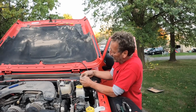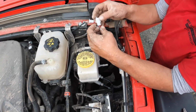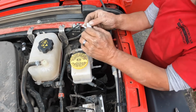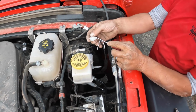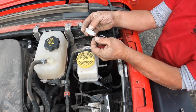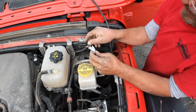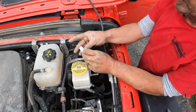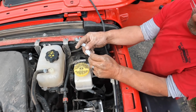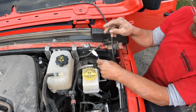Now we'll put the pins back in. We'll line up our connectors here. Red one goes in this cavity. There we go. Black one goes in this cavity, in this direction. We need to make sure that we push them in until they lock into place. There we go, heard the click. Now the white one goes in this cavity, this direction for the tab, locked into place. And the last one is our blue wire, which, if you remember, matches our yellow wire. Tab goes in this direction, locks into place. And our plug is together.